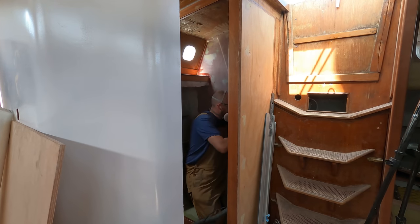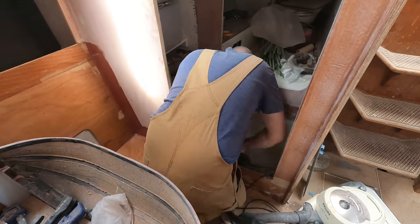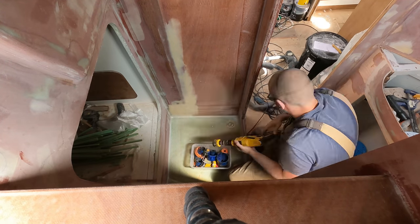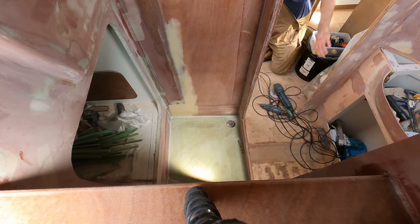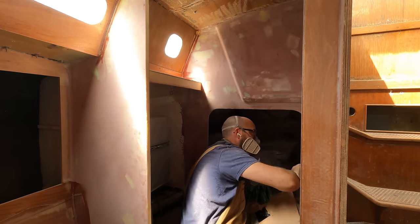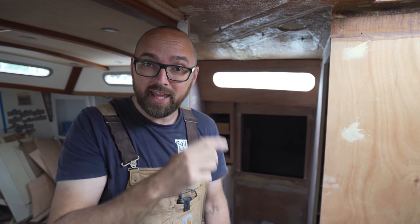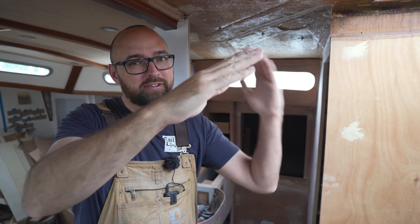I'm going to paint the hatch at the same time I'm painting the head to save a little bit on rollers. Next morning I sprang into action — little did I know that I'd end up spending the entire day in an endless loop of sanding and fairing. Before I got too far into the sanding I decided to cut the hole for the drain and also dry fit the stainless steel angle that's going to secure the poop tank cover. I also wanted to figure out the position of the hatch that'll allow access to the seacock without removing the cover. Dusty, sweaty, noisy work. Things are not perfect in here but I have reached the much sought after intersection between wanting a good result and not being able to stand another second of fairing — so I guess we're done fairing.